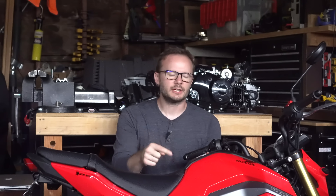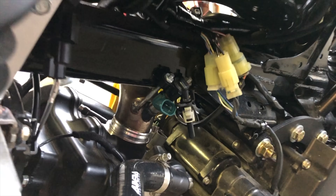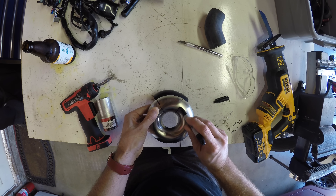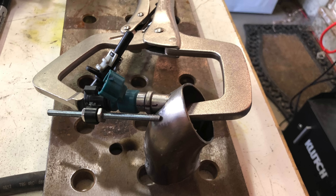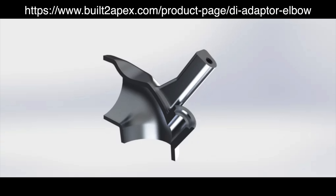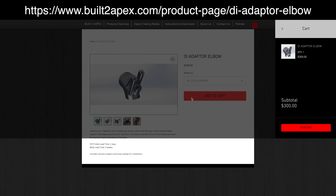One additional thing: the fuel injector. The fuel injector location is not ideal. Remember when I told you this thing doesn't idle very well? With that bend in the intake between the throttle body and the engine, the fuel doesn't atomize correctly at low RPMs, and the bike just sucks below about 4,500 RPM. I fixed this by designing a metal angle that replaces the silicone tube that comes with the kit — this puts the injector right near the engine so it can spray directly behind the intake valves. You need a really tight bend; I got mine from a stainless steel donut — a 1-3/4 inch outside diameter bend with a maximum bend radius of 1-3/4 inches. Cut a 90 out of the donut, leave out an injector boss, weld on some all-thread, put a little dent in to clear the frame. About the time I was finishing mine up, someone started selling these things — it's probably worth buying if you're trying to get maximum power out of your engine.